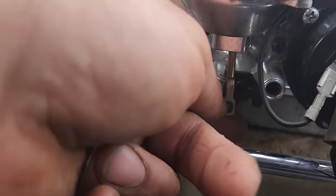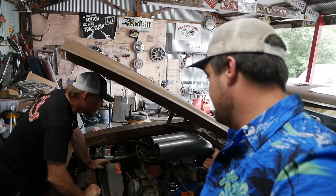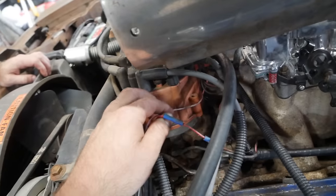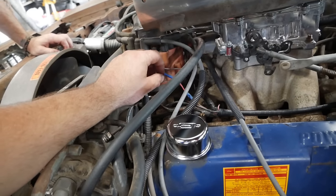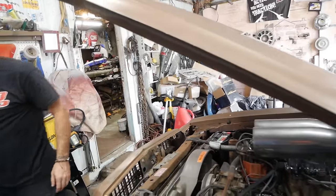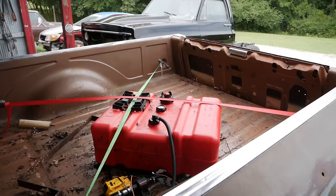It doesn't feel like it's gonna kill us now. We're going to go really slow — seatbelt interlock still works of all things. Pretty uneventful drive back home. Running a lot better actually. The problem is probably the carb we put on — I don't have any bigger carbs, only 650s. The distributor power wire has an inch-long splice in it — we can fix that and make sure it has 12 volts all the time. It's probably a points car originally and may not have had 12 volts consistently. We'll check that, pull plugs, and throw a new mechanical fuel pump on it. Ordered a new gas tank — it'll be here later this week.